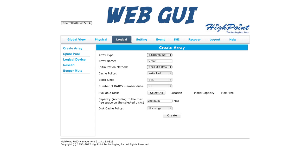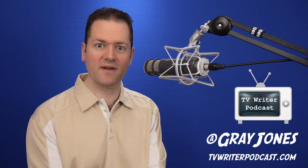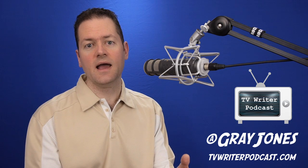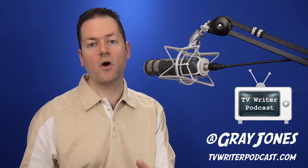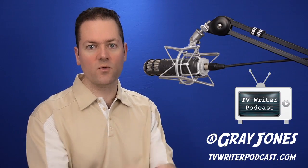The Rocket Raid 4522 has web software to set it up — there are essentially three steps. When you first install a fresh drive, it has to be initialized with the High Point drivers. Then that makes the drives available for however you want to create your RAID 5 array, which you do within the web GUI. Once you've initialized that volume, it's made available to your operating system, where you use your OS tools to format that volume. I would encourage you, once you figure out which option you have, to consult the documentation to figure out how you want to set it up.